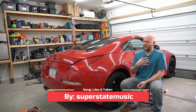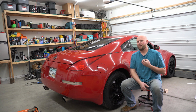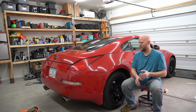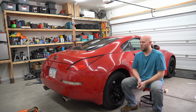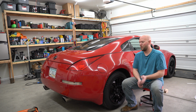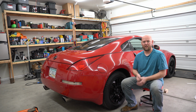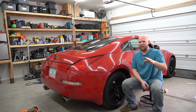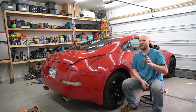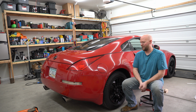A lot of people get upset that I don't put torque specs in my videos anymore like I used to, and that's because I found out through comments that people are taking those torque specs. So let's say I say the wheel lug nuts on this car are 80 foot-pounds. People were taking that and putting it on their Altima and doing their Altima tires at 80 foot-pounds because I said that my application was 80 foot-pounds. That's not on me. It's 100% on you, but at the same time, I don't want you to just do what I'm doing because there's variables everywhere, okay?